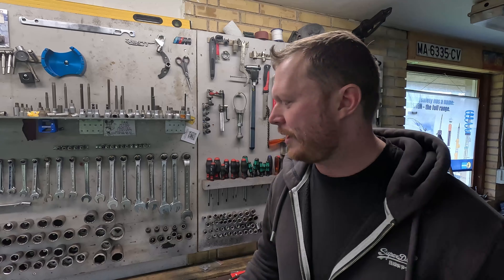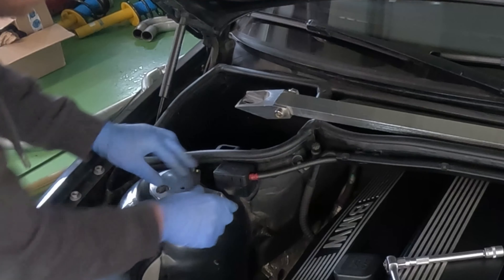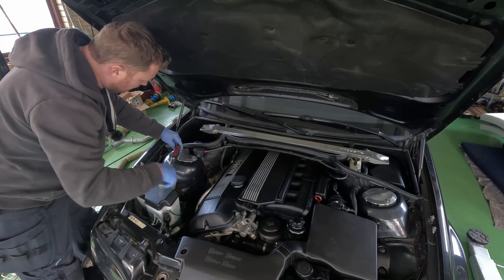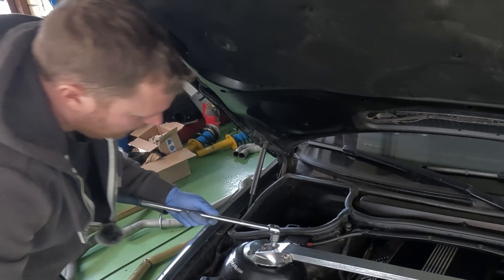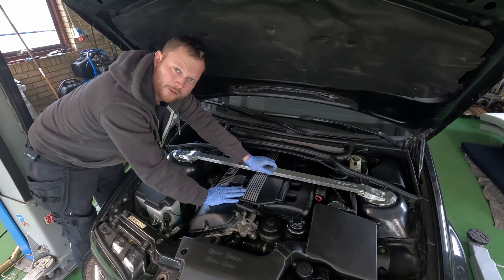With all that said, now come some of the easier mods which should actually translate into more tangible gains. We'll start with a strut brace. Torqued to 20 newton meters. These here I don't have the torque figures for, so these will just be a good and tight. And this must be one of the easiest mods you can perform on your car.